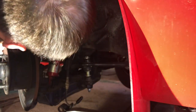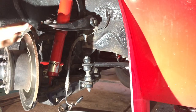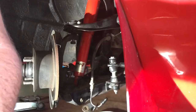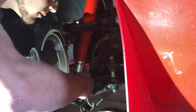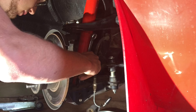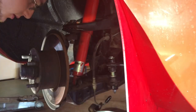I'm going to go get my pickle fork — I've never used one of those before, but we'll see how good it does releasing these. We're going to need to remove the lower shock attaching bolts right there. See, it's just a nut and a bolt, one on either side. A 15 millimeter wrench on either side, and it's free. There it goes. Done.